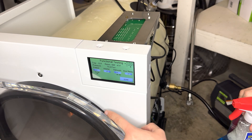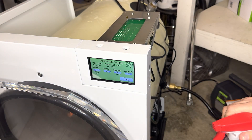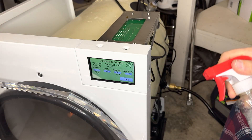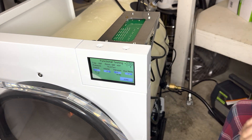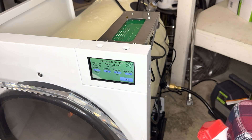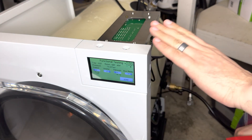Some people do like to check their gasket area. Some people use soap and water, some people do whatever. I personally still use Windex because after I'm done with the test I'll take all this apart, wash it again, and then do my next load. As you can see, our mTorrs really didn't change on any of those areas.